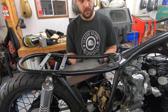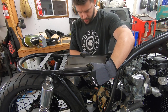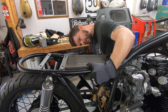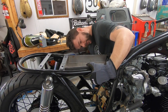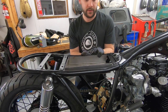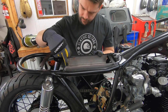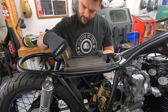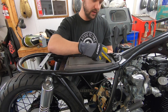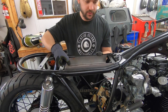Box is bent up — it'll look pretty good. You'll be able to see some of it sticking out of the bottom, maybe half to three-quarters of an inch, but it'll be painted black so it won't stick down nearly as far as some of the ones I've built in the past. What I'm thinking is I need to weld up this back seam, then add a piece with a 90-degree bend to run two mounting tabs. We'll also do a cross connection at the front to strengthen it and give us another mounting point — same way I've mounted all of my battery boxes.